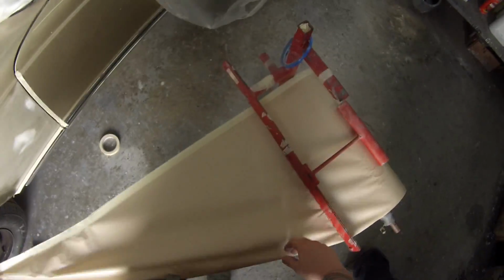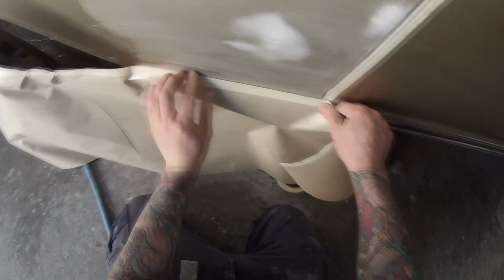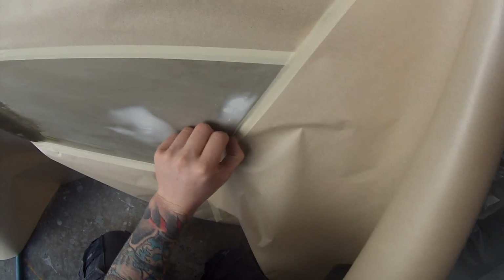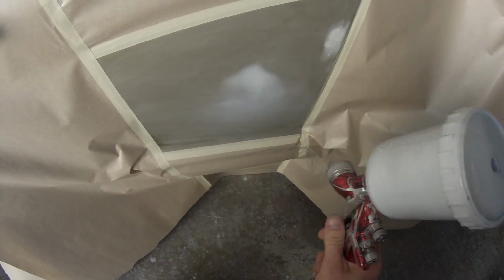However, to find this colour myself, for those of you who are not familiar with the Standox mixing system, it has a tool called the Spectrophotometer Genius. It's got 3 cameras on it. The new one's actually got 5 cameras. You place the machine onto the paintwork, it takes a few photos, and you then plug it up to the computer and it scans the database for the closest match. On this car, from memory, it was actually a Hyundai colour that it ended up finding. It decided it was better than the actual Mercedes colour, so I mixed that up and then colour matched it from there.